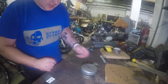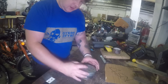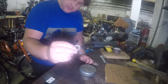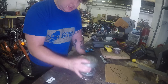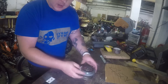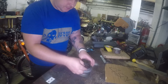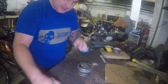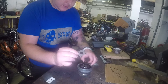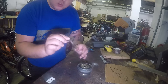I got the variator off the bike that you just saw me start. I'm going to take it apart both directions. Starting from the back — going on to the crank — you've got your rectangular washer, clutch bell thing. Now we're in the variator, and this is where you need to start paying attention to order. That's your starter plate, single round washer. I run two stars — it helps delay the variation, gives me a little better bottom end, but you only need one.